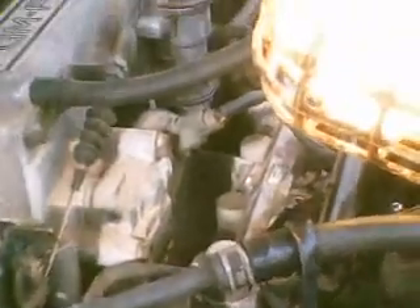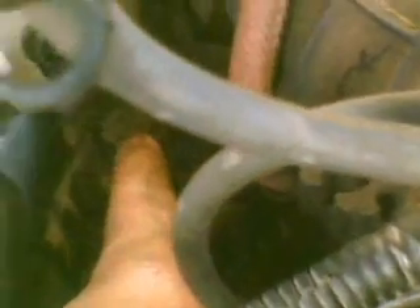Now what makes this hard? Here's the old fuel filter down there. You want to disconnect this top bolt first and release the pressure. That's a 17 millimeter bolt and it comes off. It's actually quite stiff — I had to use a big breaker bar here. It was so tight.